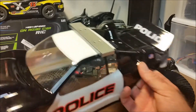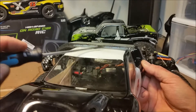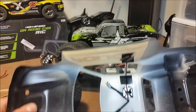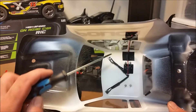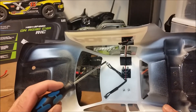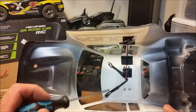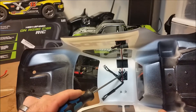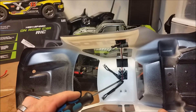Now we'll take a quick look at the light bar itself. You can see that this light bar mounts with four screws right to the body, and on the front it's got red and blue LEDs and on the back are amber LEDs. Now if we turn this over you can see underneath I've got my wiring. Originally this came with much longer wiring for the two sets of buttons. I elected to shorten it and wire them directly instead of using the quick disconnects that it comes with. These buttons control the way the lights themselves work — it's got independent control of the amber and the blue LEDs. It's also got the main power which is what I've routed here, and I just used a little sticky with a wire tie to fasten it and to keep it from putting stress on the end of the wire itself.